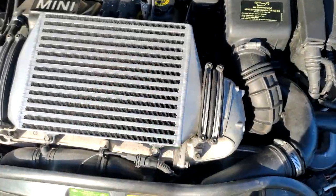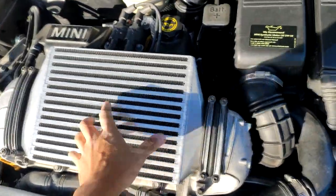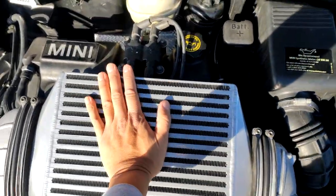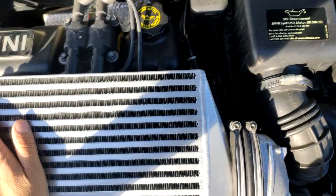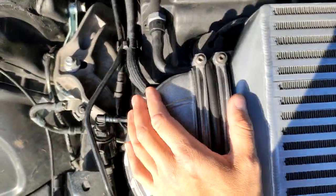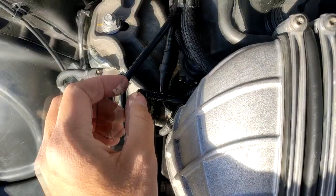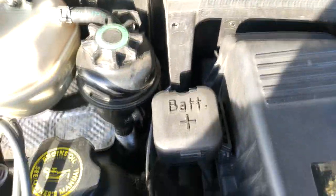When done installing the boost gauge, reinstall your intercooler assembly. In my case, I upgraded to a GP inspired intercooler I got off eBay for under $80 brand new. It has a protective coating and is larger than the original intercooler, which was my main objective. Don't forget to reconnect anything you disconnected, like the evaporative return line and other vacuum connections. Double check your work to make sure everything is routed correctly and there are no cracks in the pipe, otherwise you will have a severe vacuum leak.